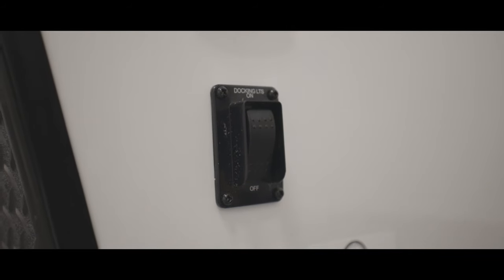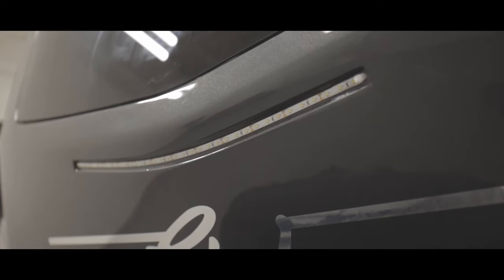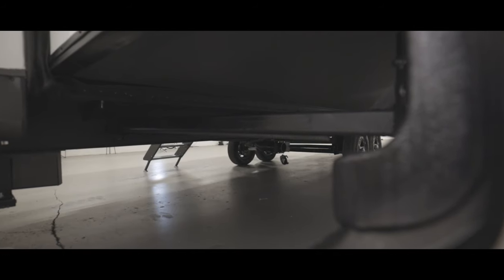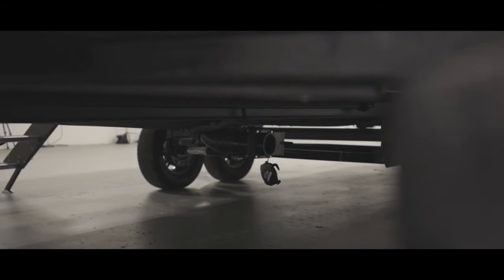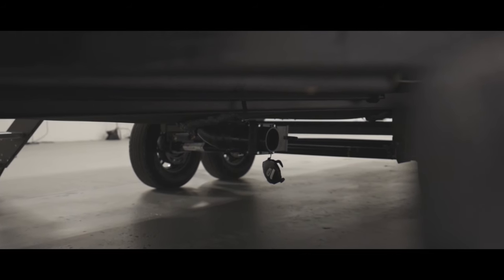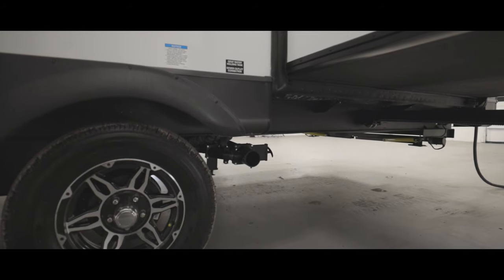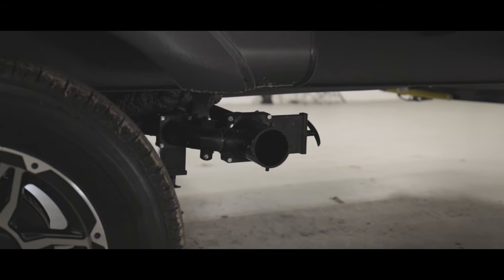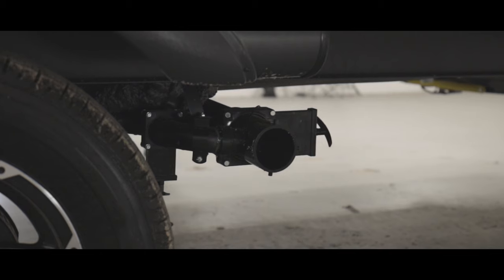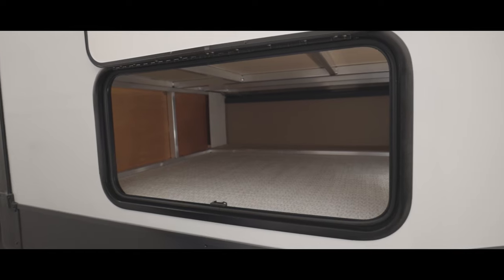Moving around to the off-door side of the RV, we have the switch for the front docking light. We know that sometimes you have to hook or unhook the RV from the tow vehicle while it is still dark, so we put a light on there just to help with that process. Located under the frame of the RV under your front slide out, we have your drain point and valve for the front gray tank — this tank would be for your kitchen sink. Always make sure to empty your tanks before traveling to keep from having the water slosh around as you drive, and it also adds extra weight. Right here behind the tires is the drain point for the remainder of your gray and black tanks. Reminder that you should put enough water in your black holding tank to cover the bottom of the tank to keep stuff from piling or getting stuck. Here behind this door we have the access to the storage that is located under the bed — we wanted to make sure to give you as much access to it as possible.